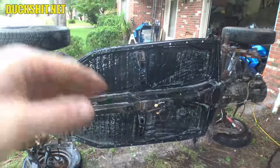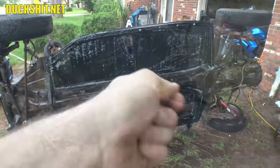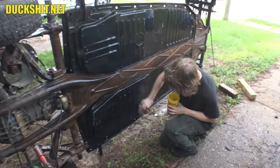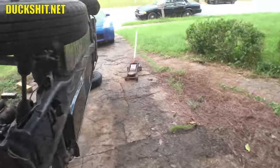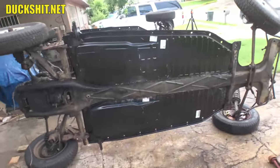If you've used phosphoric acid before, you'll know that once it dries it leaves a white powdery residue. You can wipe that off with a wet rag, or if it's heavy, use a wire brush gently — trying not to scratch through the iron phosphate layer. Off camera, William repeated the rust treatment for a few more troubled areas, then we washed it down once again. This is Robert's pan — it's looking great. And for whoever wants to call me out: yes, we did peel off the stickers before we painted it.